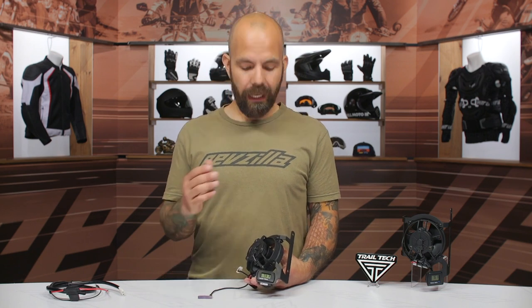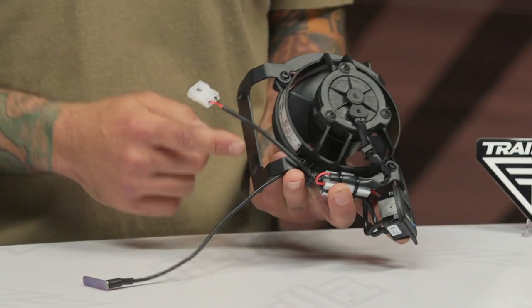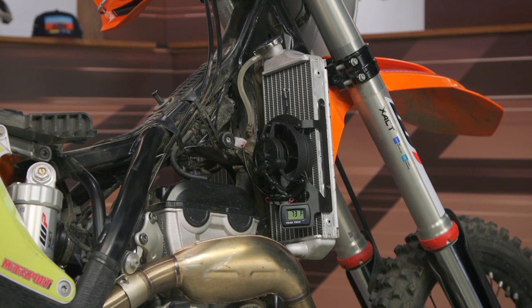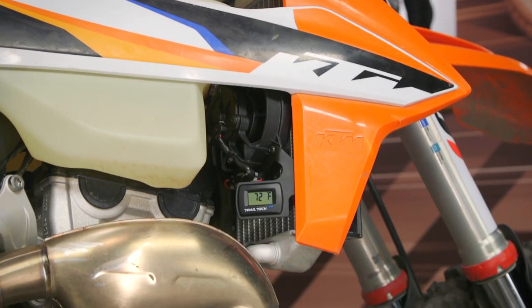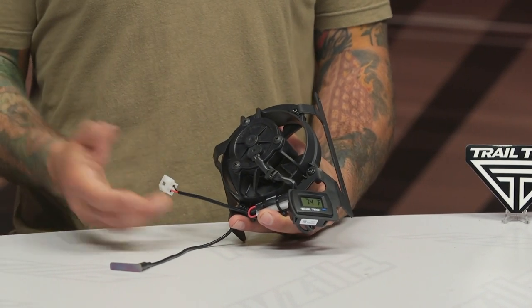When it comes to installation, you will probably need to take your gas tank, your seat, your radiator shrouds, and your radiator off the motorcycle, and then screw this to the radiator. You'll need access to the screws on either side of the radiator — they are self-tapping and included. You will need to drain your coolant, which is a good opportunity if your bike is due for service. For most folks, you're looking at maybe 45 minutes to an hour with just standard hand tools. Really easy to install since you don't have to tap into any coolant lines or wires — everything is plug and play.